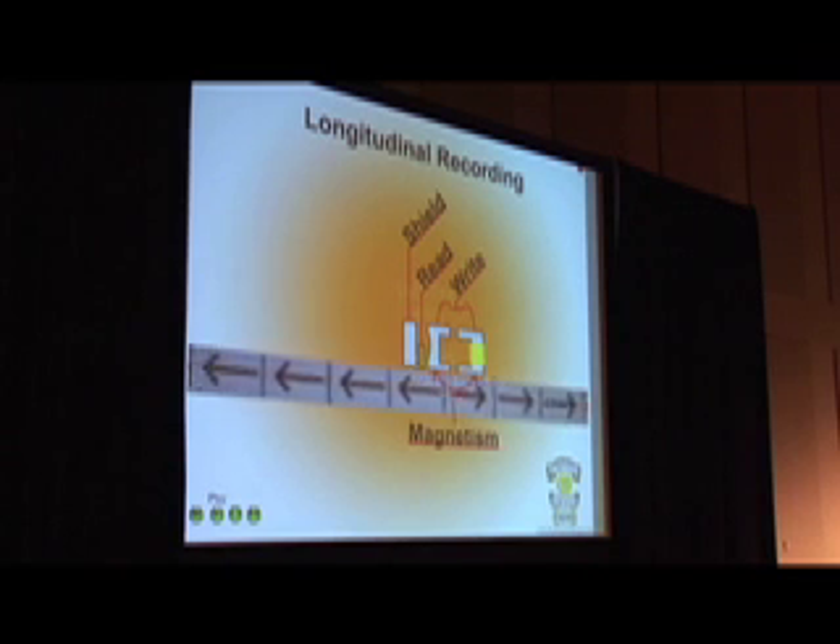There's been a major change in the head. The head itself was done for simplistic reasons to make it look like this. On the website forensicspeak.com, there is a link to what IBM has made — the new GMR head of the platters itself. The head has changed quite a bit, and they use a type of metal now that they glue together that can read differences in magnetic information as it passes under it. It's very complicated, so this piece was done for simplicity to give you an idea of how this data is written back and forth.